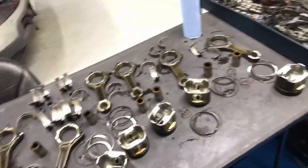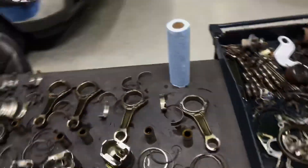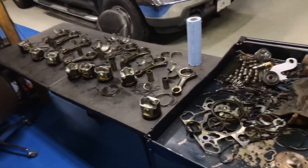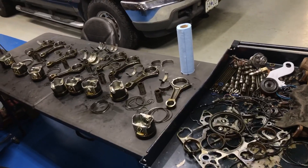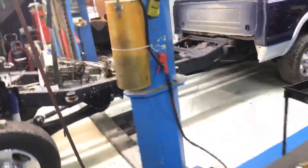It might have had a little bit of low oil pressure — you wouldn't see it on the dash, you'd have to put a mechanical gauge on it — but it might have been just a little low with that side clearance that big across the board. Only one of them was down to 19 thousandths, which was the closest. That side clearance is like the leak for oil pressure — it's what lets oil come out, and too much of it means less oil pressure.